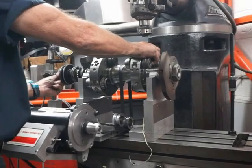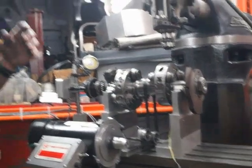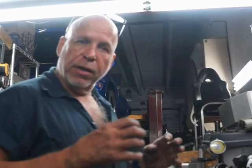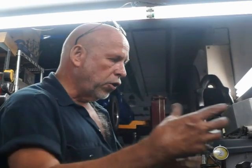I put a mark on the puller so it always lines up with a certain position of the crank. It could be random. The whole idea is to take any possible variables away. There's always, however minute, a residual minuscule amount of imbalance left in either the mandrel or even the reluctor in the pickup. It's minuscule, it's tiny. But when you take it off and put it back together as you go through setup, especially with the rotors, you have to take them off, go to the mill, grind some off and come back. When you're dealing with weights heavier than 3 grams, you actually have to do it in the machine. If it's under 1.5 grams, I'll do it by hand.